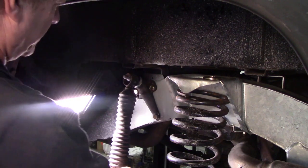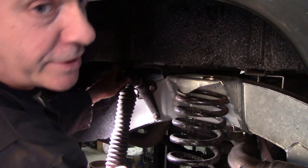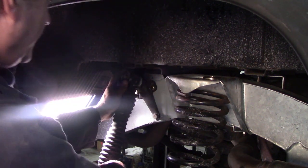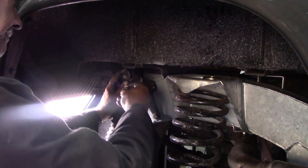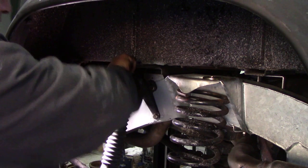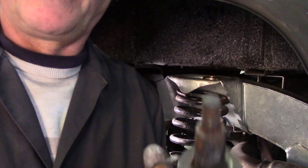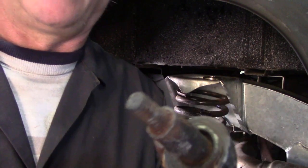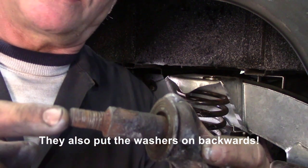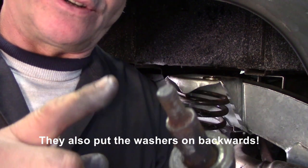These are a bit rusty, but can't change everything. They were a bugger to get off — an absolute nightmare. Put a new nut on and spin it down. I've changed those brackets for some good used ones, because when we took it off, our old friends who built this before had put inch-size bolts on metric threads. Not good.